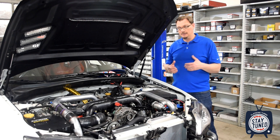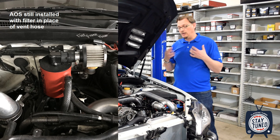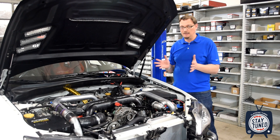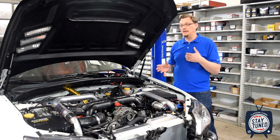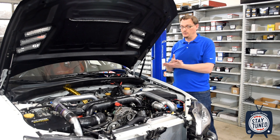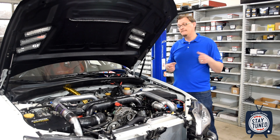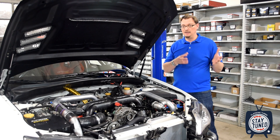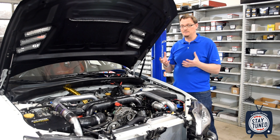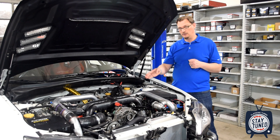We kind of caused the problem to a certain extent by leaving the air-oil separator on last year with a filter. The rationale was to prevent too much crankcase vacuum from forming, and at the time, without our vacuum check valve, that was probably the best starting point we could have had. But having that open filter meant that the scavenge pumps - which are pretty efficient - could send as much air as they wanted along with that oil return back to the tank. That, I believe, is what largely caused the problems we were having with the tank overflowing. We were seeing too much air and allowing the oil to get frothed up on the return path to the tank, and we just didn't have the capacity to let that froth and pressure dissipate before pulling the oil back in.